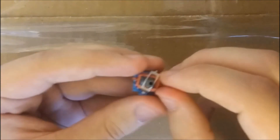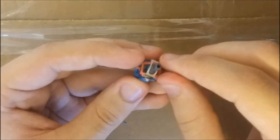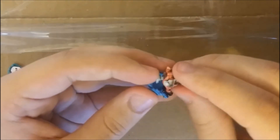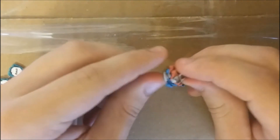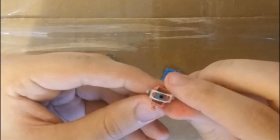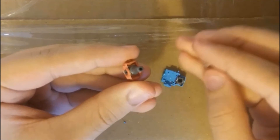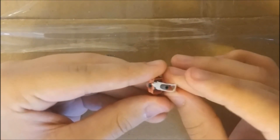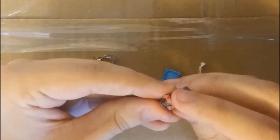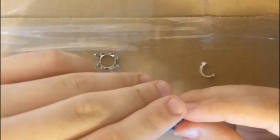And here is the metal shield that goes on top — it's holding everything together. Going really carefully so I can show it correctly: basically you have two axes right here that are pushed up by a spring underneath. This is what is always centering your joystick back to center, with the help of those two plastic pieces. I'm going to try to get them off gently. This is one axis that does the job of keeping it centered, and there is also a red one. This piece is also what presses the button on the side when you click on it — pressing the button right here.